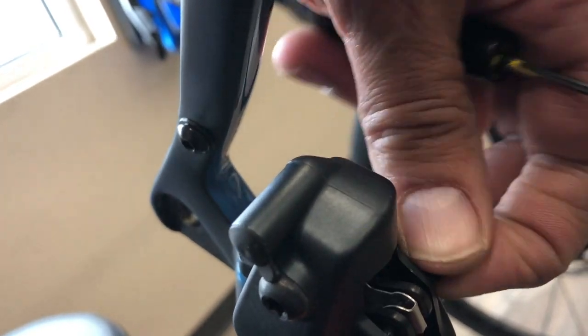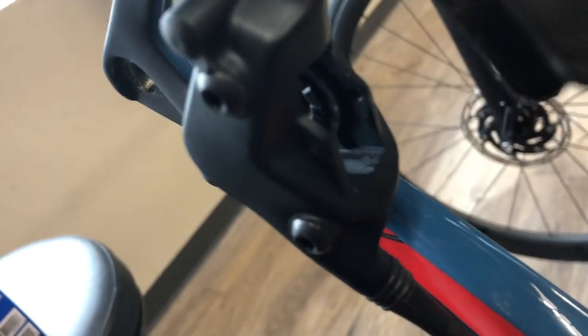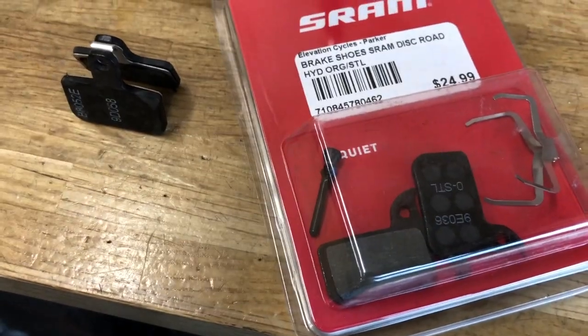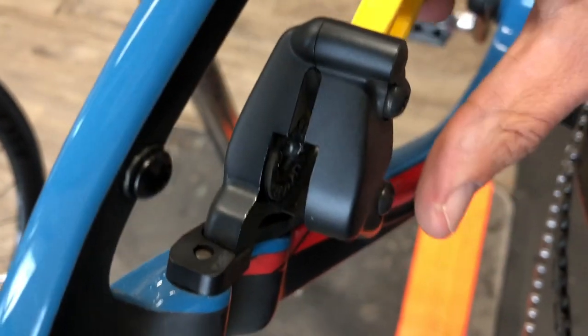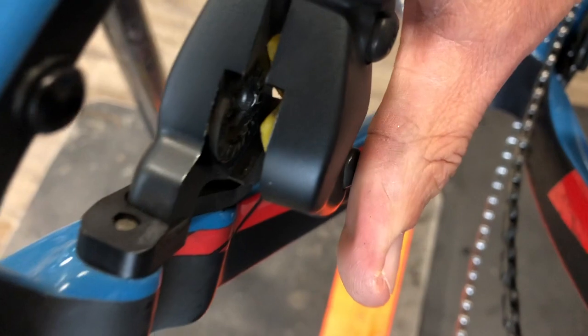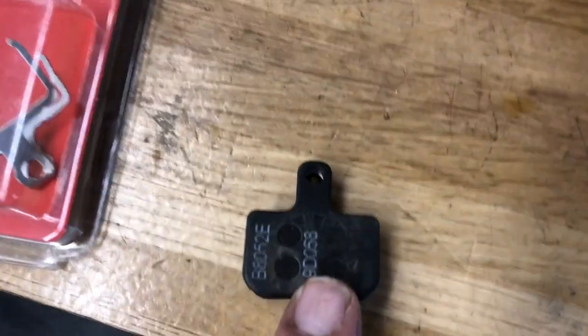This process, as far as a hydraulic brake — be it SRAM, Shimano, whatever — it's all pretty much the same process. Some Shimanos will have a little cotter or split pin that holds them in, or they'll have a little pin or bolt like this. Another method: if you just pull the pads out you can reset the pistons back in with a plastic tire lever — just be careful with the Shimano ceramic pistons, they're kind of prone to breaking easily.